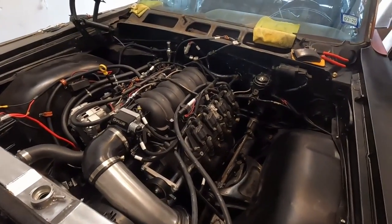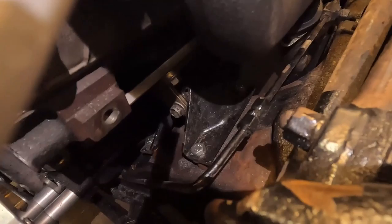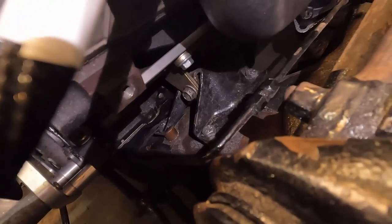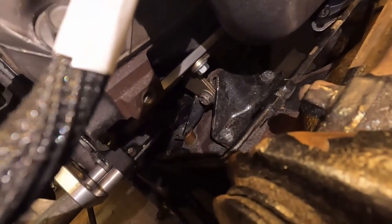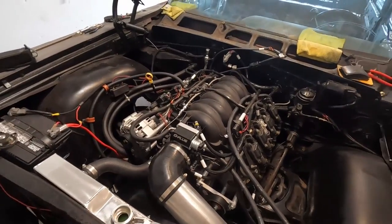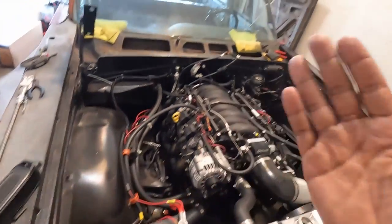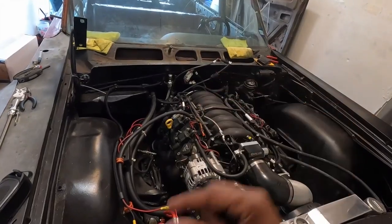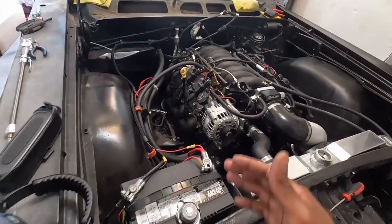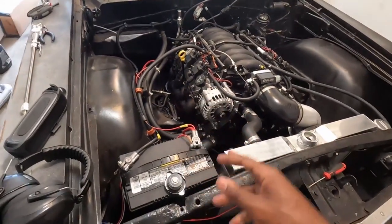I'm going to start off by talking about mounting the LS. As you can see, it's on stock Chevy mounts with a three-quarter inch spacer below the bottom mount. I also have an adapter plate. The top mount is actually a different brand I got on Amazon — I had to shave the side of it just a hair, but it bolted up fine. At first the pin was hitting the crossmember, but the three-quarter inch spacers fixed that.